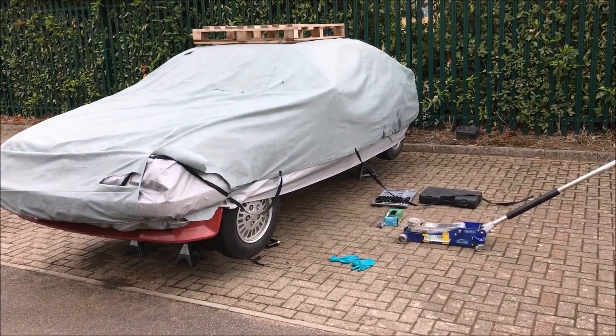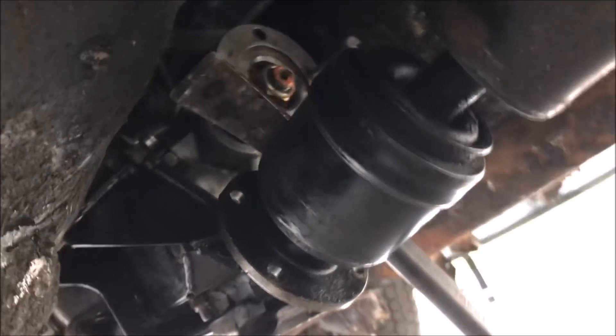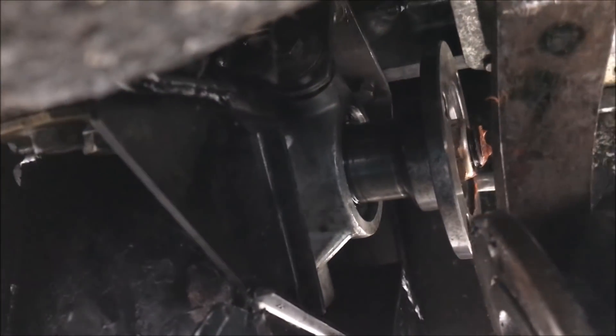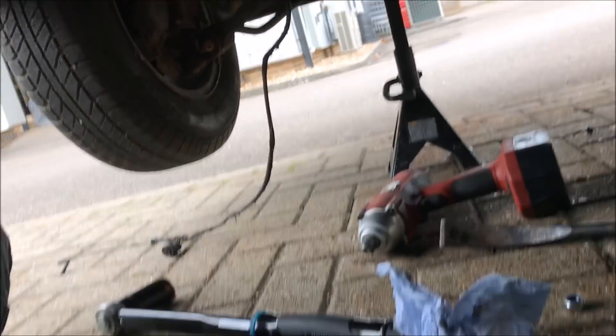It's the day after. I know the clutch is working now, so I'm just putting the prop and exhaust back on. One thing I didn't quite cover in the other video was torquing up the rear nut on the output shaft. I've put sealer around it because when I looked at the front side of the prop I could see oily dregs — clearly it was leaking, coming out past the nut. I degreased it all and put sealer on the nut and washer. It has to be torqued to 205 Newton metres, which is a lot. To stop the engine rotating I put an old bolt and a big lever bar in there and torqued it against that.